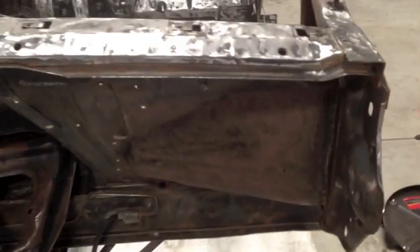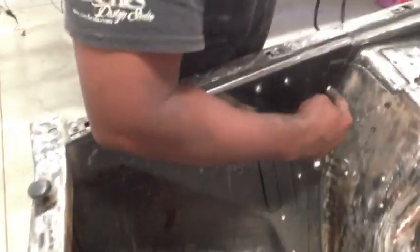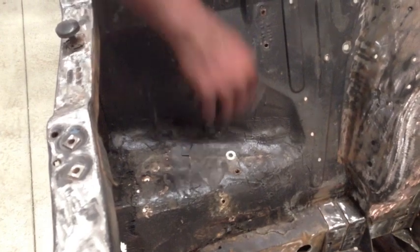We're going to do undercoat on the inside part where the fender splashing is happening, and this area is all gonna be bumper black. We're not touching this panel because it's going to be cut out and a new one put in — we're about to order one of those shortly, and we'll be bringing in welding to swap it out.